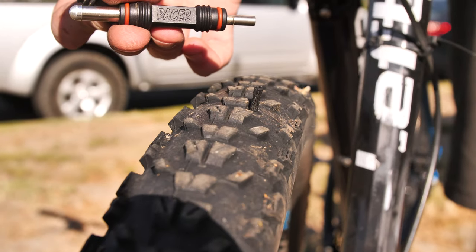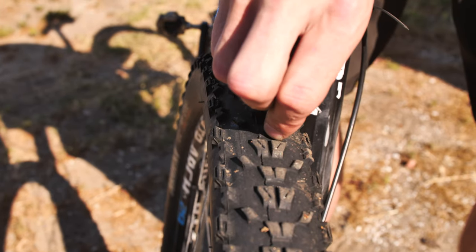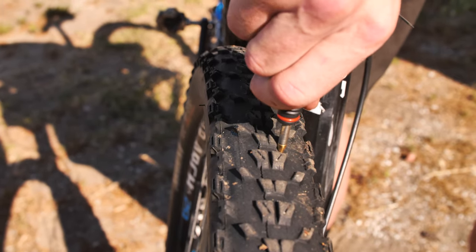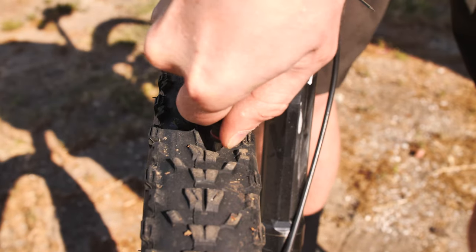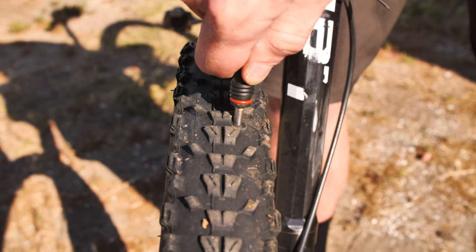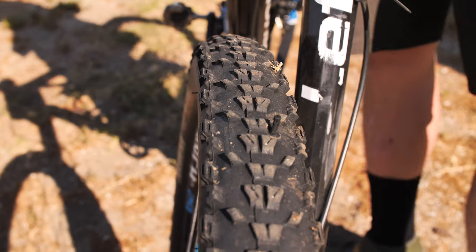This side has two different sizes — kind of the spearheaded side and one of their soft tips, and more of a bullet rounded end. The repair plugs are constructed from a viscoelastic rubber impregnated cord and non-abrasive brass tip. To use the Dynaplug you simply align it, push in, and pull out. Pretty simple and straightforward, a great application to get yourself back on the trail. And the repair can last the life of your tire if installed correctly.